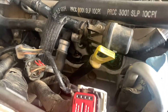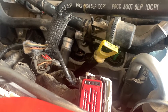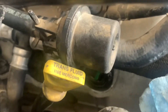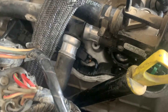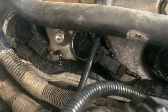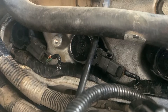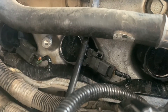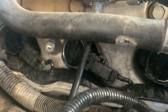On this side I had some issues with the plastic connectors - they're just so brittle. Three out of four busted: one busted as soon as I pushed on it to release it, and the other two busted when I put them back together. What I did was put a zip tie around the connector after sliding it on and cinched it down - that gets it snug enough so it doesn't slide off. If you run into that, this plastic does get brittle with all the heat. If it breaks, don't panic - a zip tie works great.